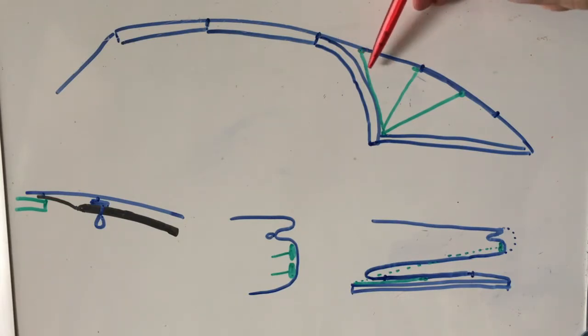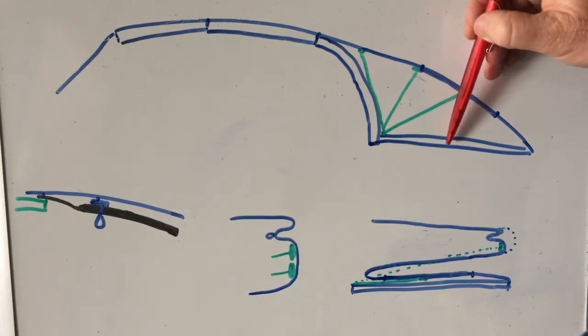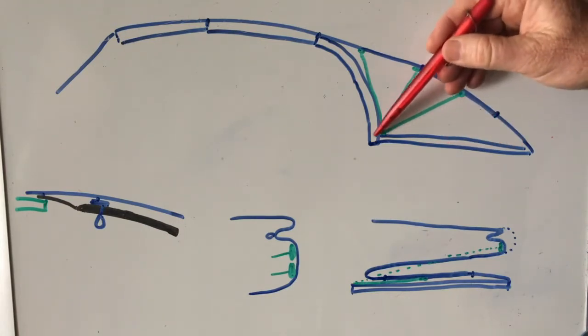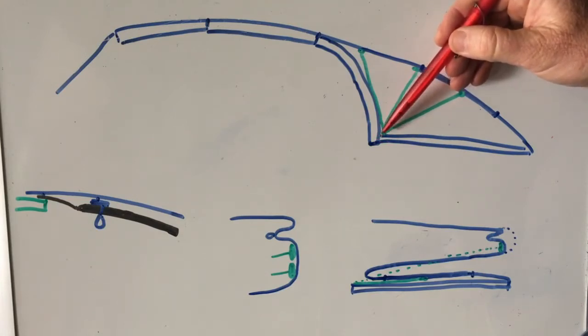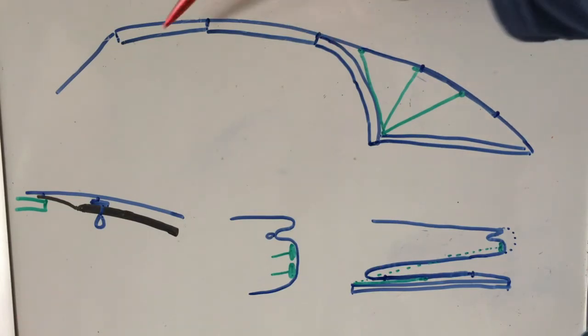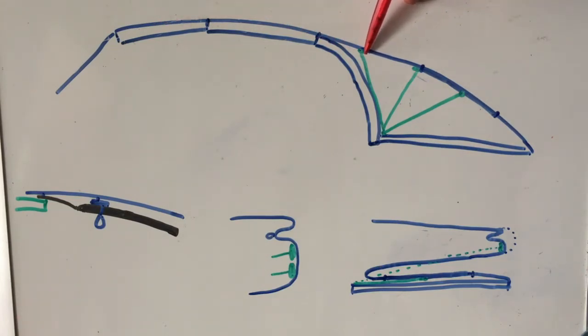And these actually float. So this lever, and this lever, and that one as well, when the roof is half retracted, you can just grab hold of those. They pivot around a number of points down the bottom here near the motor. But these bits just move back and forth as required, and they just get pulled into place as it goes up. There are a number of bits of webbing that are the correct length to actually join these together, so they go to the correct position, but they just fold down into the correct position, and everything collapses when the roof goes down.